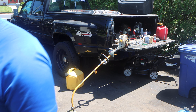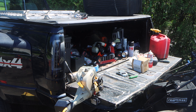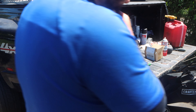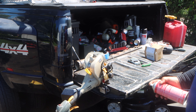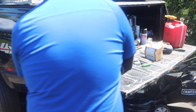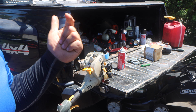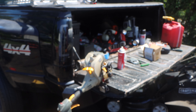Nonetheless, this came in and I broke one of my cardinal rules — when these machines come in for repair, no matter what it is, I just order a new carb kit, because that carb kit comes with fuel lines, filters, everything, the whole shebang. This machine had broken fuel lines and I put new fuel lines in thinking that would be the issue, and it still didn't run. So we know it's a carburetor issue because they hit it with some go-go juice. See how it runs and dies? That's fuel. By doing that, we confirmed the other facts that control the machine to run: we confirmed air, compression, timing, and spark. Fuel is the missing thing — once the go-go juice runs out, the machine stops running.